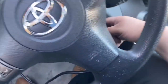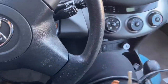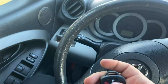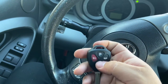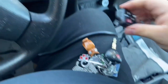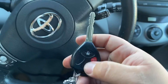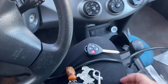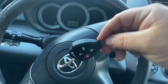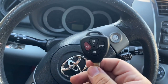Let's try the keys out to make sure they work. The new X-Horse key works perfectly. If you don't have a remote for a certain Toyota, you can go into your VVDI Key Tool, enter the FCC ID you need, and make it for any vehicle you need.